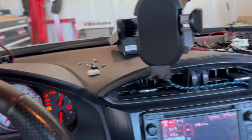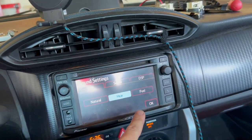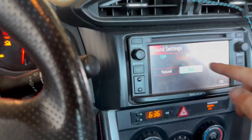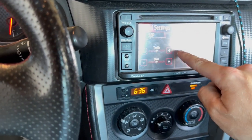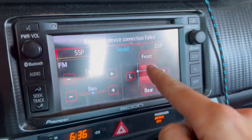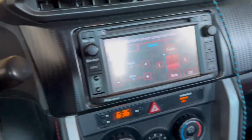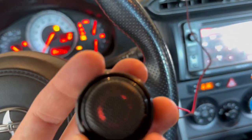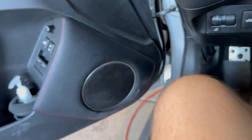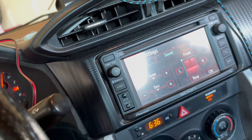The last thing to do is turn your car on and test everything out. Go to the sound settings and switch the balance to the side you just worked on, then turn up the music. Put your ear at the door speaker and hold the tweeter up to your ear. If you can hear sound from both, everything is good. Once everything sounds right, you can start buttoning everything back up.